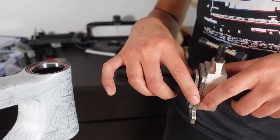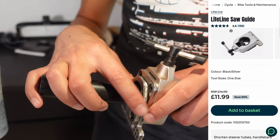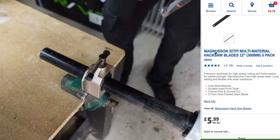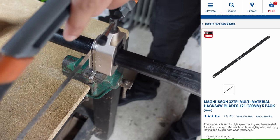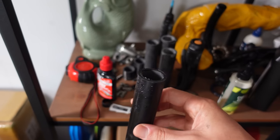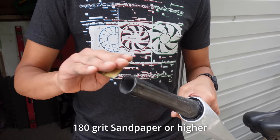Wrap some tape around the bar to prevent fraying when cutting, and when placing the cutting guide on the fork make sure you're aligning with the right mark — the one you made. I've got this nifty little jewelry vise; with the cutting guide in place we can securely clamp the fork steerer tube into the vise. For cutting you want a fine-toothed blade on your hacksaw or a carbide blade — I'm using a 32 TPI blade — and remember to keep the blade and fork moist with a bit of water. Now that we've made our cut, I'm going to take that little bit of excess carbon and place it on my memory shelf. To finish off, give the newly cut edge a good sanding so it's nice and smooth. And don't forget to remove the tape.